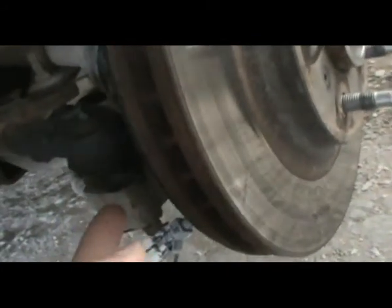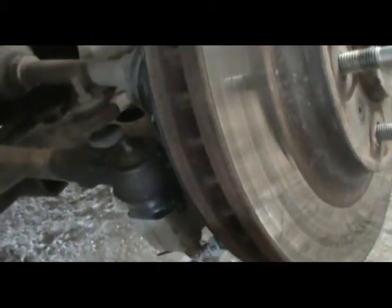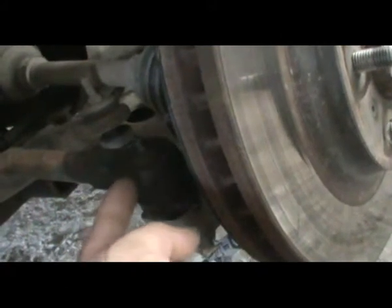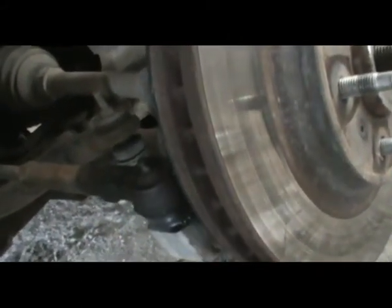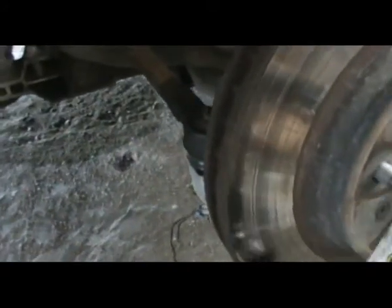See, grease is leaking from it. That's the bubble I told you about — if you fill it with grease, it'll inflate. Now because I jacked up the car, you see this bubble kind of inflated, but it's really not. If I put the car back on the ground, this thing will push against the tie rod and squeeze this little bubble because it's ruptured and the grease is coming out. So the metal will be hitting against that metal — that's the noise you hear when you drive: clang, clang, clang, clicking noises.